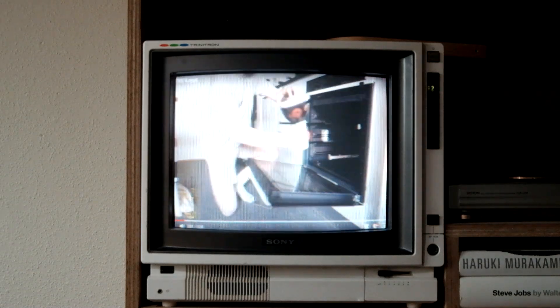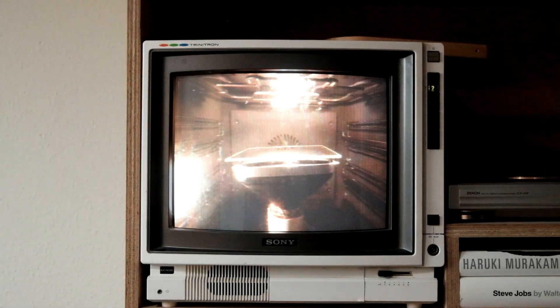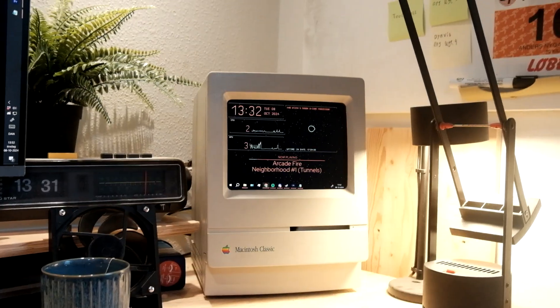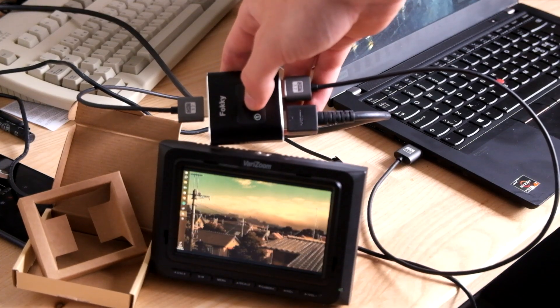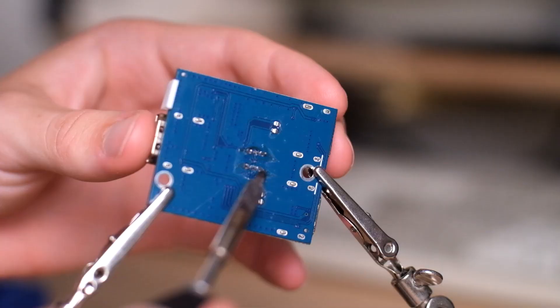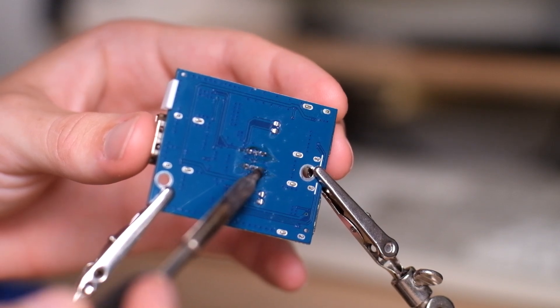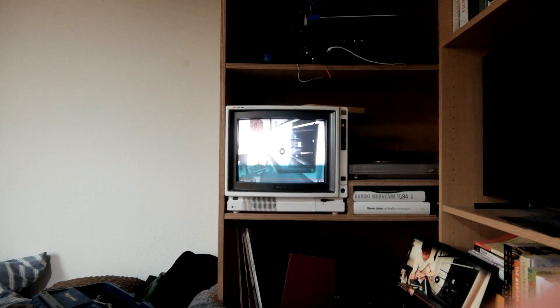This project didn't totally go as planned. There are two features I wanted but did not go into the final build. First, I wanted to mimic the curved glass of the CRT display, so I bought an acrylic plate and melted it over the CRT to create the curvature, which surprisingly worked well. But it created a lot more screen glare and basically turned the monitor into a mirror on a black screen, so I decided it was not worth it. I also wanted to use an HDMI switcher to choose between the two sources, but this did not work due to my own incompetence in soldering. This just goes to show that not everything in a project like this works as planned — and that's okay, because now you've learned something from it. Thanks for watching.